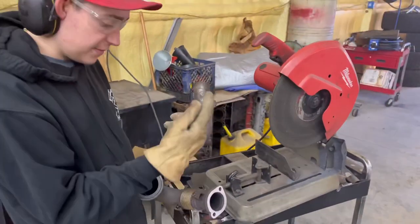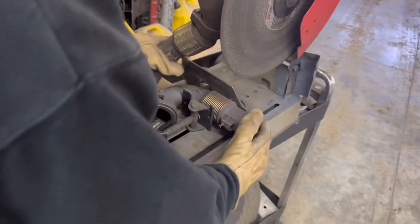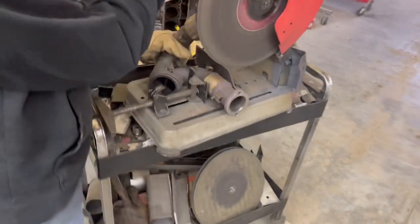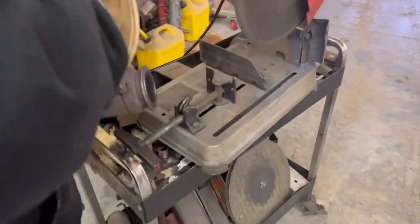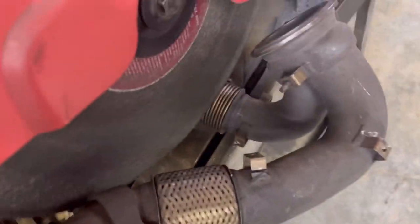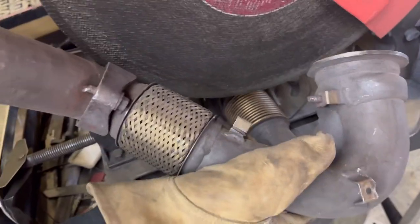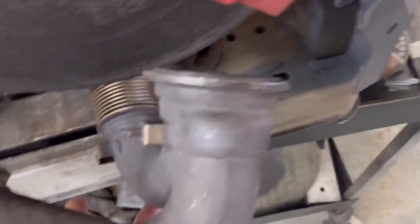Because when I'm cutting this one, I want to hit that. You're going to cut that and then it'll trash the whole thing. Okay, we'll just let him go. And now can you see here too? Right here? Yeah. See if you can get past it. Maybe you can cut it on a little angle. But when you start the cut on an angle, leave it on that angle for the whole cut. You don't have to cut it straight. You might have a hand somewhere down here.